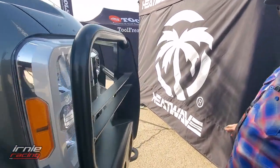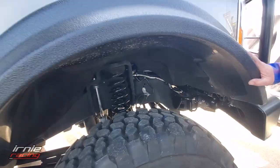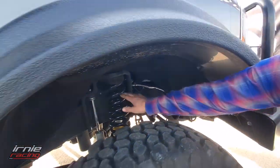It started 10, 12 years ago with wildfire trucks because they can get off road. We only do a 3-inch kit to get a 41-inch tire on it. Keeps it nice and low. A 3-inch lift. Yep. And, not on this one though, or no? Where is the actual lift plate then? No, it's a coil spring on this. Oh, you replaced the whole thing? Replaced the coils, yeah. Okay, so you resize it. You do that for all your kits, the springs? Yes, or sometimes it's a spacer. And sometimes we do a spacer on the bottom as well, like in our level stage one kit. Yep. It's a spring spacer.